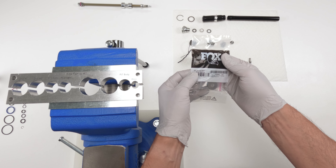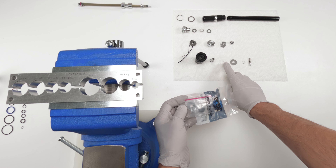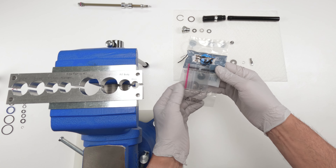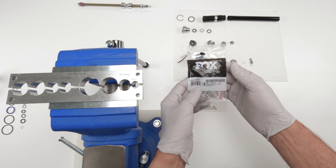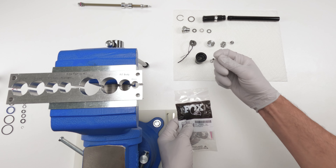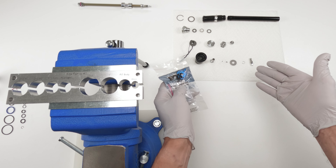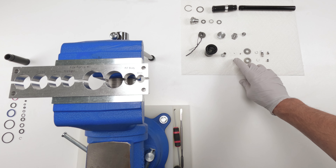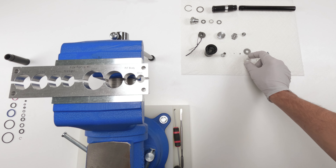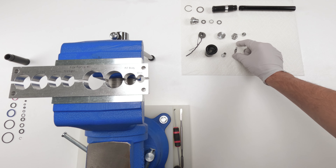It comes with the top cap, the ball, the spring, the washer, and the clip. Out of curiosity I went looking and came across kit 820-05-330. That was a total waste of time cleaning if I'd remembered earlier. The bearing in this kit actually looks pretty bad shape — this isn't even round, looks like it has a chunk missing from the side. So that is garbage. The spring — cleaned but garbage. The washer pretty much looks the same, but garbage since they give us a new one. And we have a new screw.